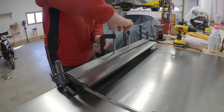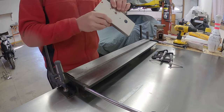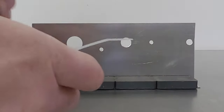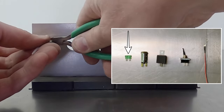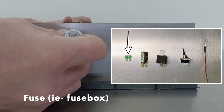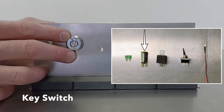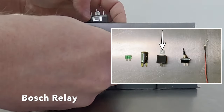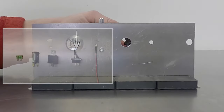I'm a big believer in hands-on learning, so rather than look at a wiring diagram I built this fixture to demonstrate how everything works together. We're going to build a circuit which is basically a simplified version of my fuse box. This plate represents the power flow from your battery to your accessory, going left to right. That first component is a DC fuse representing the breaker I showed earlier. Next is a key switch — an on/off switch that lets power through, feeding the relay — which gives you the lockout ability so you can lock that power out.